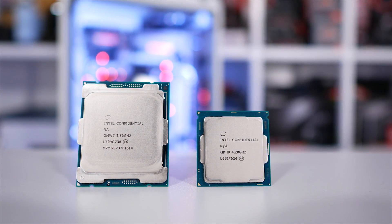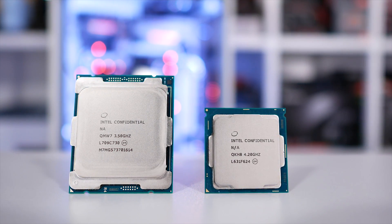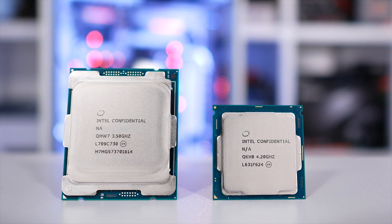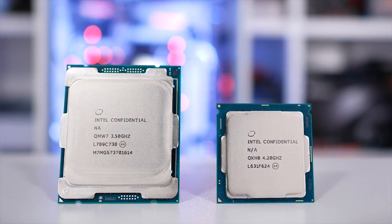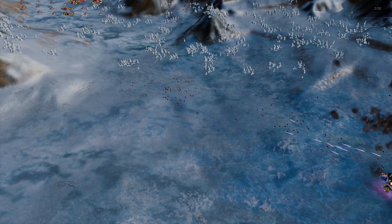So when picking your next CPU, you want to consider a good many things: How long do you plan on going between upgrades? What kind of GPU will you be using, and can you see yourself getting an extreme GPU — something that costs $400 plus — in the future? And just as importantly, what games will you be playing? My advice is not to get too hung up on the whole core count thing. A CPU with more cores isn't necessarily better than one with fewer, particularly if they are of different architectures. The CPU's architecture and operating frequency really influences how many cores you'll require for acceptable performance in games, though the games also have to be able to utilize the cores you're bringing to the table.